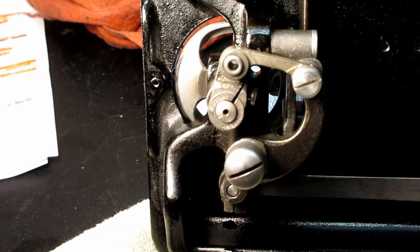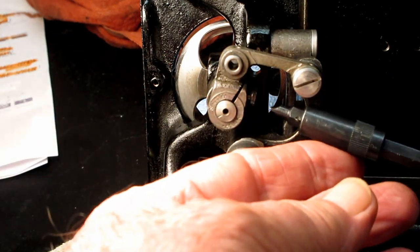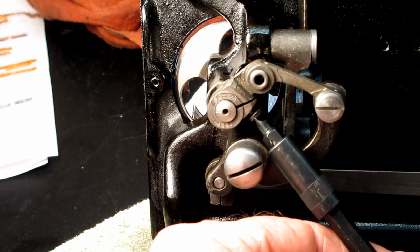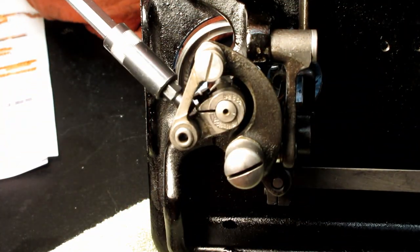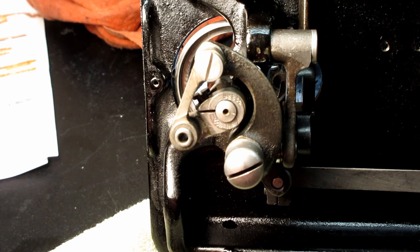So let me get a screwdriver here, and we can loosen that screw, and you can remove the pressure on that clamp, and then we can get the hook shaft out of there. Now, you can get to the screw down here like this, or some people, I understand, move it down there to get in from this angle, and you can also do it all the way over the other side and come in from behind the connecting link up there. So it's just where your position and the machine is and where you can get the most torque on it,